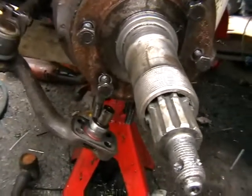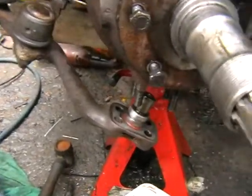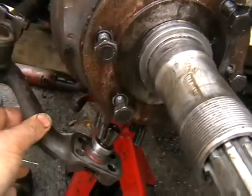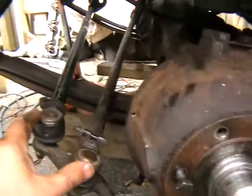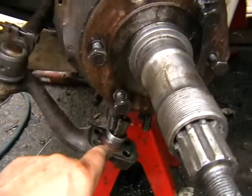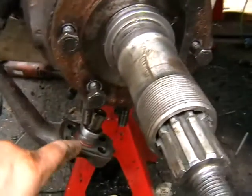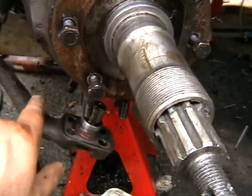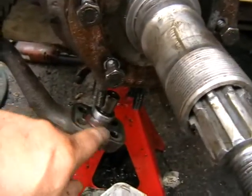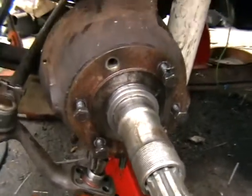Since I've had this vehicle and braked heavily, there was always a wobble on this wheel. I presumed it was something to do with the brakes being a Series tune — the brakes aren't very good. But I noticed there was a slight bit of play on this arm. All the track rod ends have been renewed, and there was an oil leak around here as well as the braking wobble. So I loosened off the tabs on the retaining washers and found this is very slightly loose — all four nuts were loose. So I've dismantled it, cleaned it up, and I'm going to put a new O-ring in and put it back together and see if it's improved.